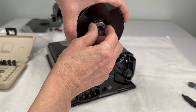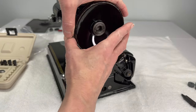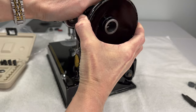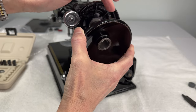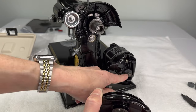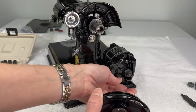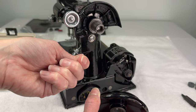Once you have the screw out, hold the hand wheel still and just turn the stop motion knob to the left — keep your hand under it so when it falls it doesn't hit any of the paint. Next we have the washer we want to take off. And finally we should just be able to pull the hand wheel off. Now if you have the belt on you may have to wiggle and jiggle a little bit more, but you will be able to pull it off and then remove the belt from the pulley end down here.